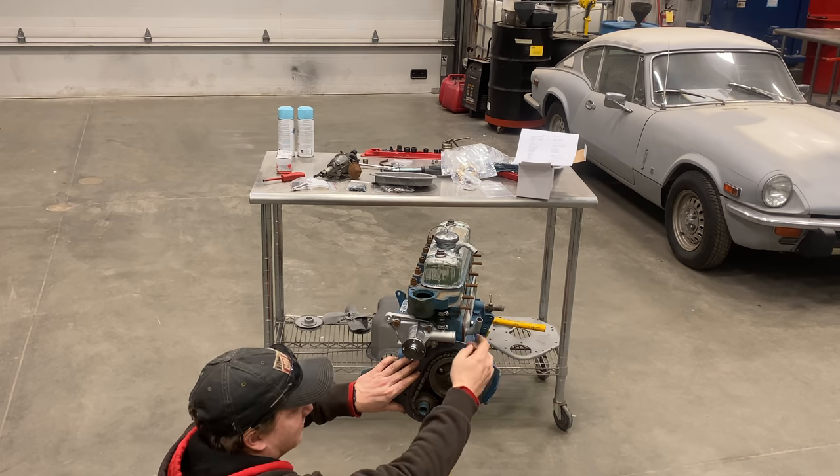I'm getting four corners of the oil pan started first. That will get all the gaskets lined up and also hold the oil pan down to make it easier to get all the rest of them started. Now I believe the torque for these bolts is seven foot-pounds, so I'm going to use my torque wrench.